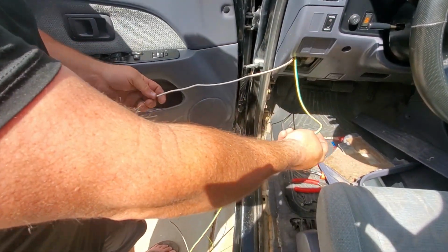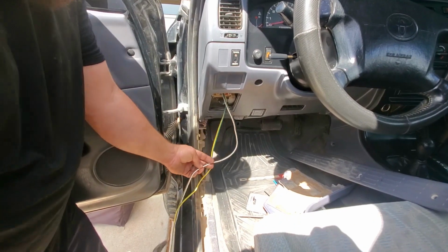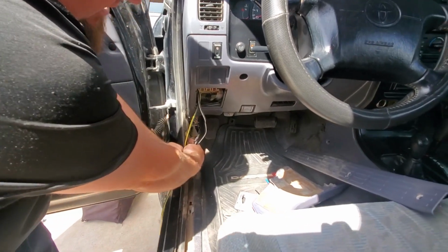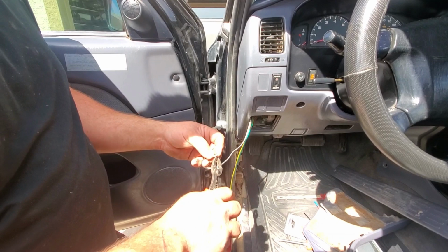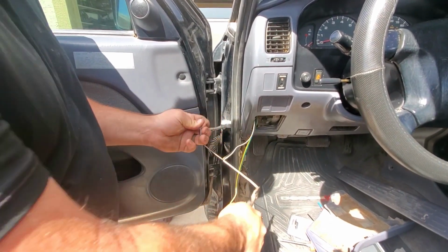Okay, to right about there, we'll be fine. Now the power and the ground wire I'm going to cut right about here. The goal is to use this screw that holds the kick panel on as our ground. So just a little longer than what we need should be fine. Alright, now we'll go ahead and separate the white and the brown wire to the same point,